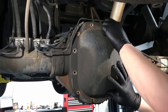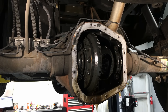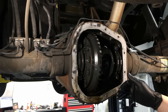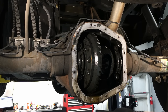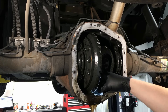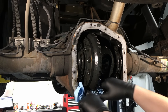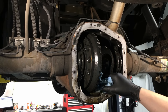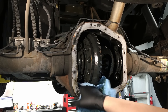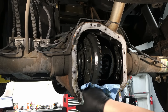Once the initial drain has happened, go inside and wipe everything down as best you can — most of the fluid just drains off as it sits. But down here in the nose of the differential there's a good-sized sump, and we need to get all that fluid out initially. This is the all-important area — very important to concentrate here. If there's any debris, any kind of metal shavings from break-in, it's all going to settle right here. We have to really clean this out to make the whole differential fluid change worthwhile.